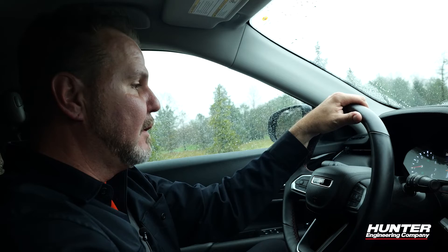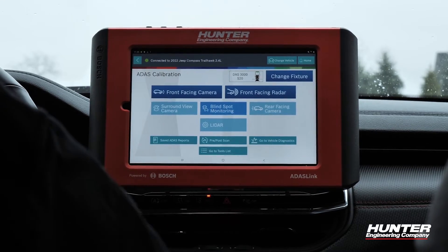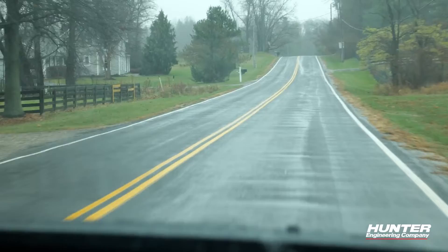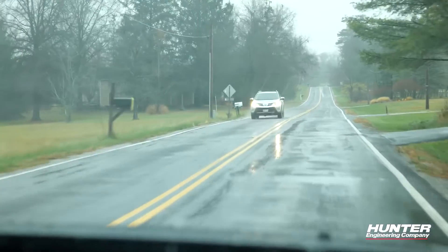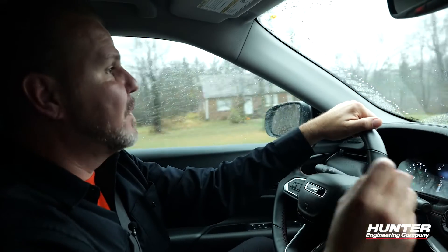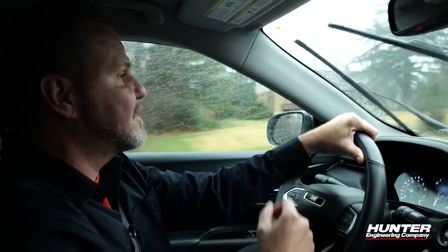The weather may not have been perfect, but we were able to successfully complete it. The last thing to do is test drive it and make sure the system is working as designed. Finding a road with good lane markings is really helpful when test driving. Make sure you're very careful — no incoming traffic that would put you in any risk of danger. You want to test that the system is going from green to white and that the vehicle is maintained between the lines on your lane departure warning system. The calibration was successful and we verified the system is operating as designed. I can safely return the vehicle to the customer along with the detailed report showing the system was successfully calibrated.